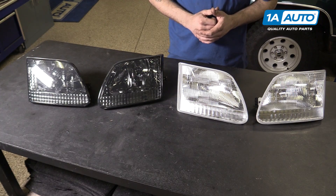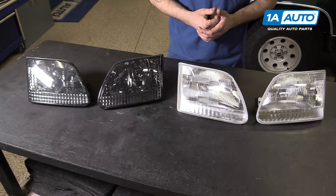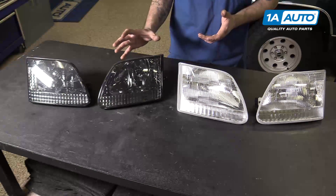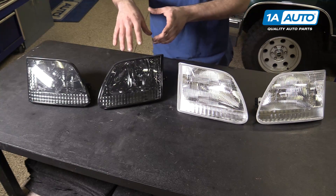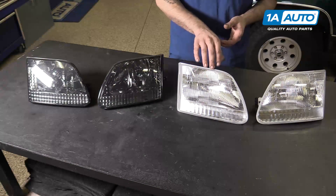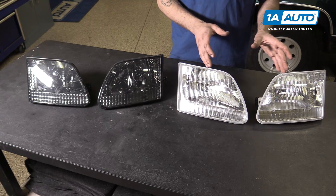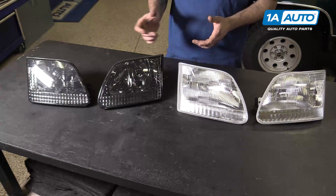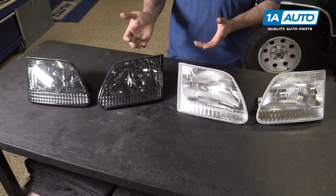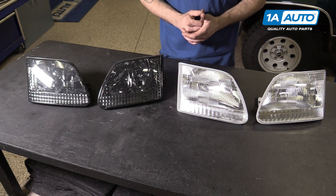Some obvious differences here: we have a smoked lens which is going to hurt our light output, and we have a black chrome type housing on the inside which is going to work against the reflective properties you want inside the housing of a headlight — because it's actually supposed to pick up the light going back and send that out forward as well. This isn't going to do that nearly as well as the clear lens with the chrome housing. So not only are these headlights brighter and safer, but they're also just like our original equipment. So if your old headlights are bad from a fogged, cracked, or moisture-filled lens, or you're replacing an aftermarket part, these new parts from 1A Auto are going to go in direct fit just like your original equipment.